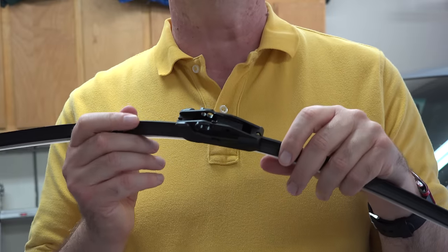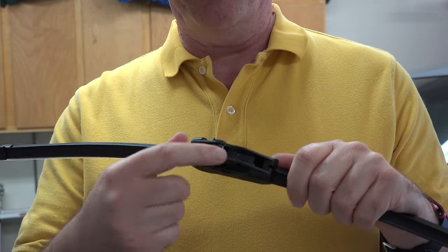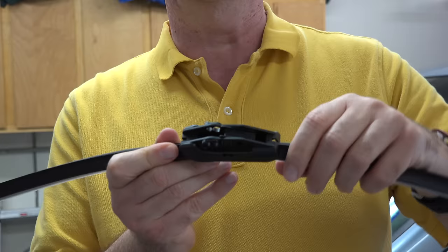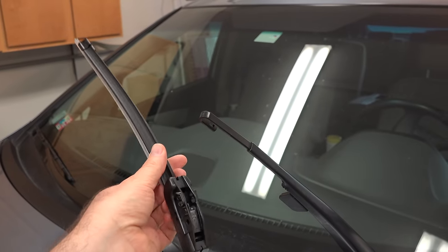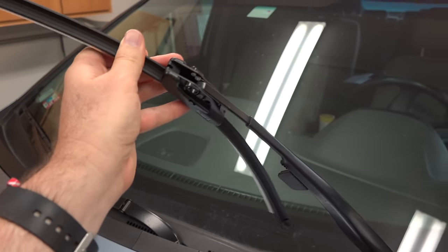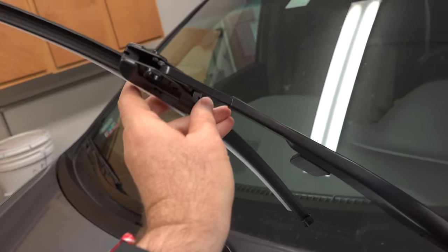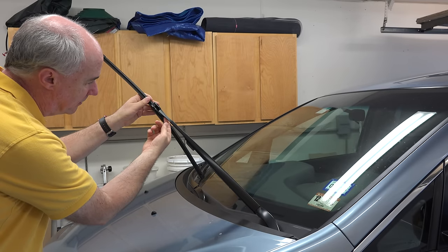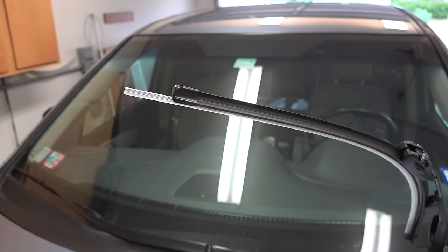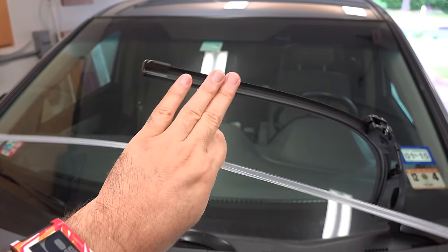The key to attaching and removing this blade from a Honda Odyssey or another vehicle with a similar attachment mechanism is the little metal loop on the end of the wiper arm. When you slide it on, there's a little piece that pops up, and when you need to remove it you have to press that down and slide it off. Here's the loop on the end of the metal wiper arm — I'm going to slide this in until it clicks, and it is now attached. To remove it, there's a little tab underneath that you press with your thumb. There's also a protective plastic piece that covers the tip of the wiper blade — don't forget to remove that when you're ready to lay the wiper down onto the windshield.